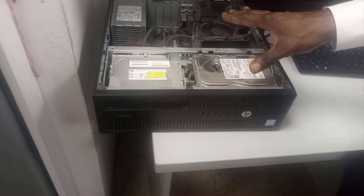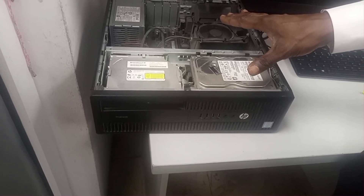Surprisingly, the beep sound changed from two long and two short beeps to three long and two short beeps, which is exactly the HP beep code for RAM-related issues. But we're not going to stop there — we're going to check the two RAM sticks separately.